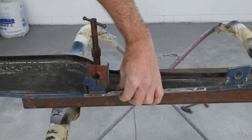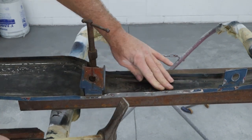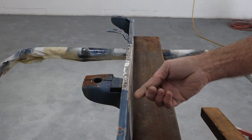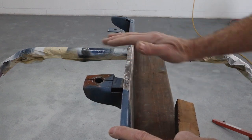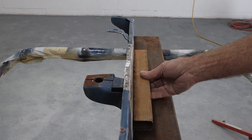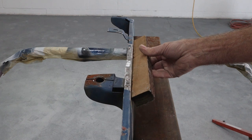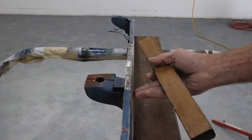It's actually starting to look pretty good — I can actually probably get a dolly on it now. After some more hammering I dollied the rib back in and it's looking pretty good. This line isn't as straight as I'd like; this roll has been pulled over and I'm having trouble getting it back. But you can see right there we've got that a lot straighter than it was. It's just about ready for quick sanding with 24 grit to see if there's any high spots. This lip right here is actually looking pretty straight — we took that extra steel out of there.